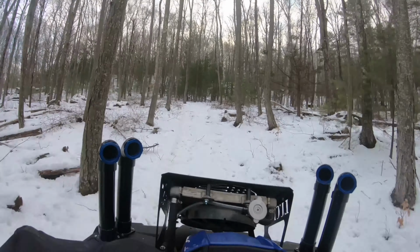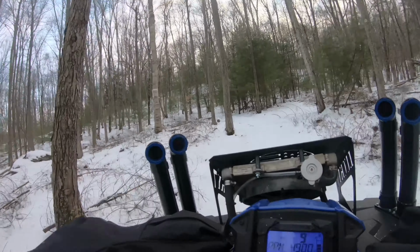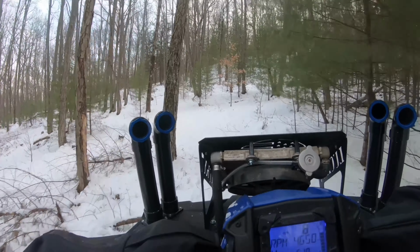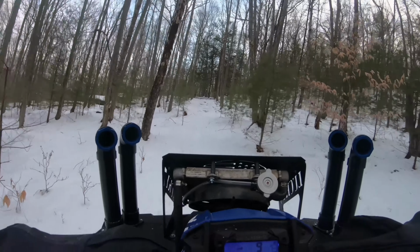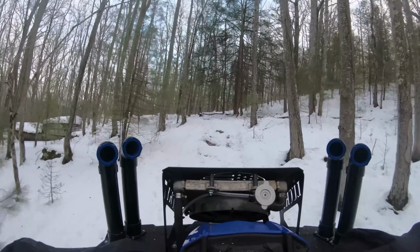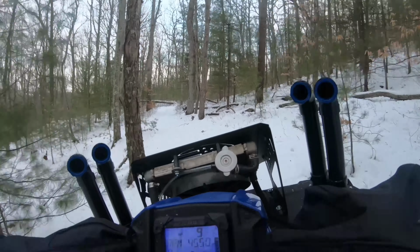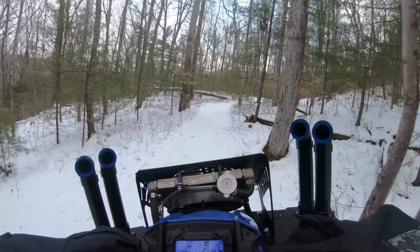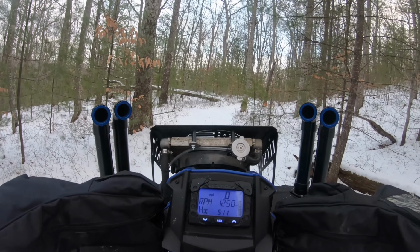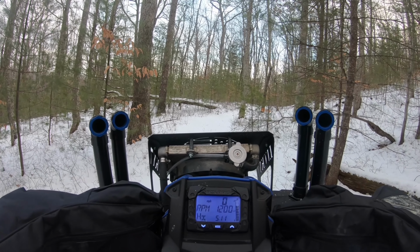Okay, today on the C&J Mudco, we are revisiting our clutch kit review. So I know I said I was going to stay with the almond colored spring, but after a phone conversation with EPI, I decided I kind of want to try the silver spring. Other than the fact that the RPMs are going to be higher, like your engagement RPMs, which I'll actually show you right now. So the engagement RPMs with the silver spring in that clutch kit is around like 2300.